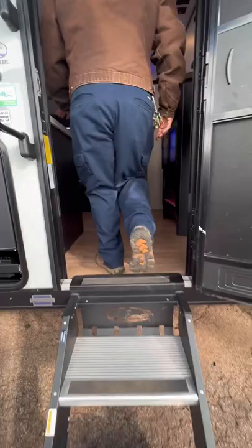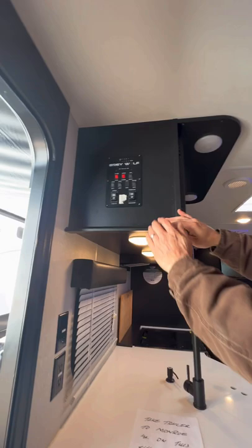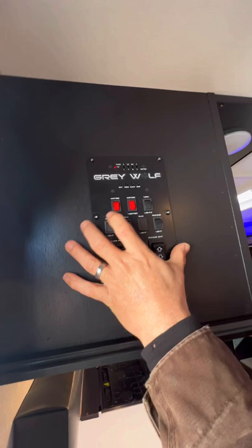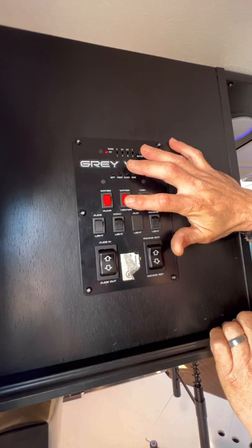Now I'm going to go on inside. Right up here is going to be the control panel for the inside of your RV. Right here is where you're going to turn the water pump on. If you're hooked to city water, you don't need the water pump on — the only time you use that is if you're running off of your holding tank. Right here is going to be the propane side of your hot water heater. Put that switch on. If you see a tank fault light up here, that means it did not ignite — turn it back off.